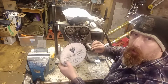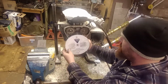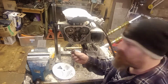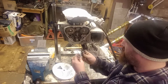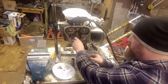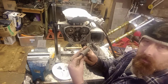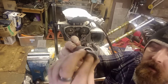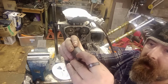Before I had it bolted on the alternator side, I'm constantly looking over the top of the motor. I figured I'd just make this thing and show you what I'm doing. Because I've replaced all the nuts and bolts, I went through the box of old bits and got the old crank timing pinion nuts, which I'm going to fit on backwards and press into the end of this tube. I've just machined a little relief out on there so that the step on the end of the nut will fit in there.